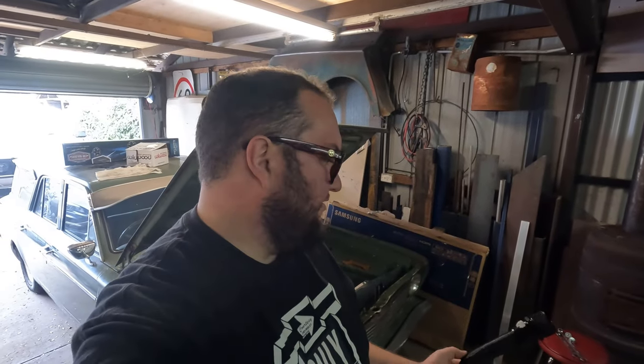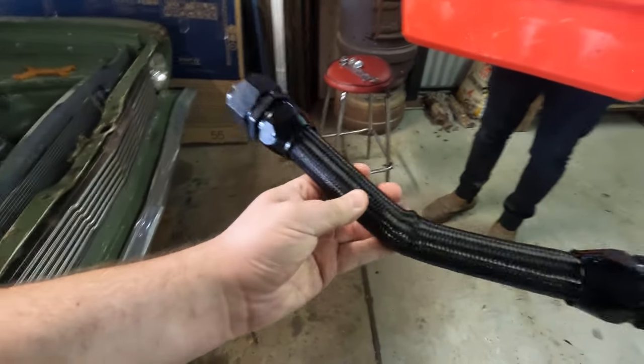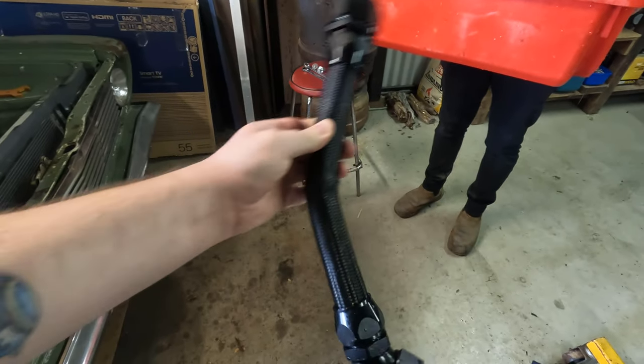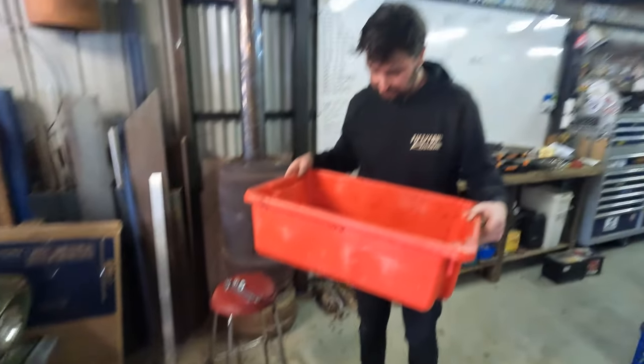One of the biggest problems, or the reason why we're lifting the radiator, is the bottom hose predominantly — and the fact that it gets a bit of an airlock in it, because the top elbow is a little bit higher than everything. The bottom hose — I tried to make it out of dash-20, but it's a bit tight, so I wound up with a huge kink in it. Didn't actually collapse the hose — there's a spring in there which you can't see. Tom's just checking the water.